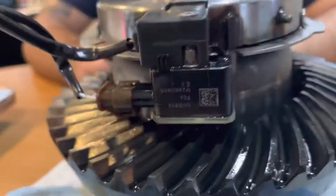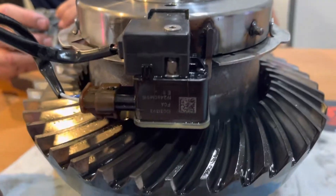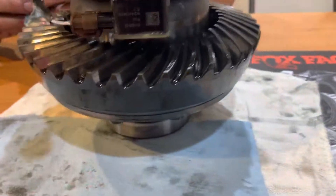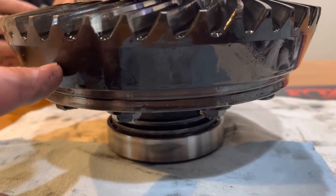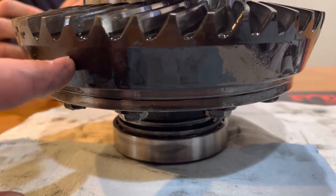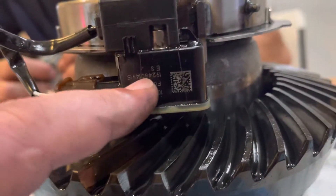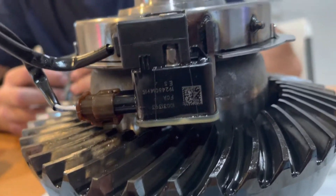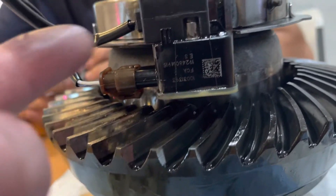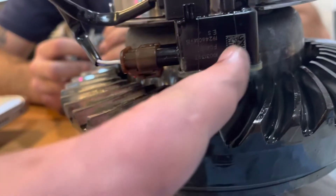But again, back to disrupting the sensor and flipping it over - there's no way around that. You have to do that to do this job. You pull it out, you sit it on your bench, you pull off your bearing, you pull all this off, you flip it over, you have to pull off your ring gear bolts, you have to take your ring gear off, you have to lift it back up, put the new ring gear back on after everything's cleaned - flat file and all that. Then you have to flip it back over again, put the ring gear bolts back in and torque them. So you're constantly flipping this thing back and forth, and this magnet is getting shaken up. Even if you turned it onto its side just one single time in the whole process, you have moved the oil around and got all those metal particles sloshed around inside there. It's grounding out on the little board in there because of all those little metal particles.